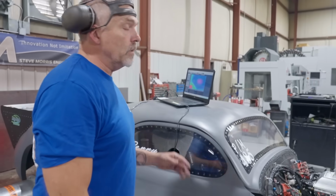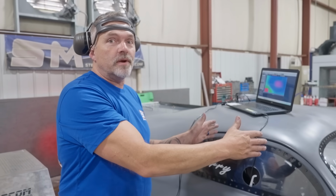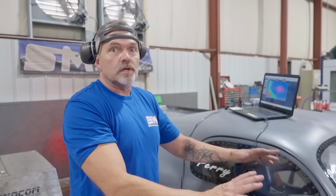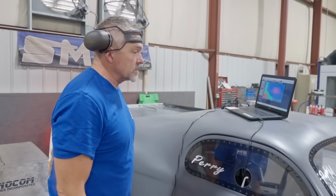Okay, that's cool. So what we did was, it's sitting here idling, and I turned off the primary set of injectors, put all the power to the secondary injectors, and it still sits there, runs, and does everything. So that's perfect. That's exactly what it's supposed to do. And then went back, and then went back again just to make sure, so everything's all cool.